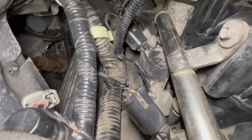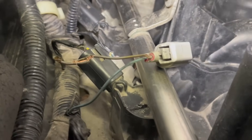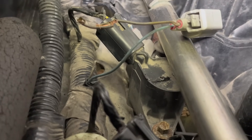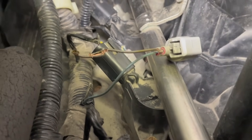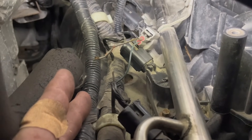It doesn't look like it chewed through like it did on number seven, so I might be able to pull this one back in liquid tape. We'll pull the insulation off — definitely an open circuit. It wasn't at the top one we first initially seen; it was at the bottom. Once I peeled the insulation off, whatever chewed into it had chewed all the way through on the bottom portion, creating the open circuit. It doesn't appear anything was shorted — it just appears to be open.